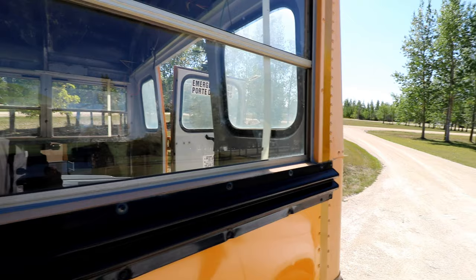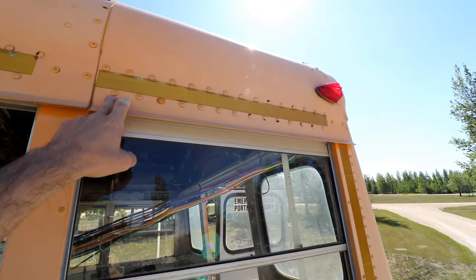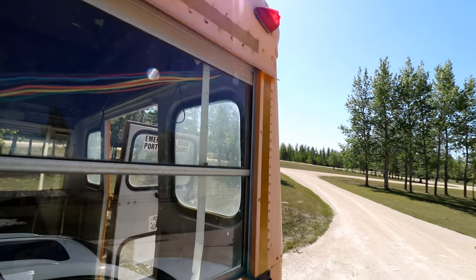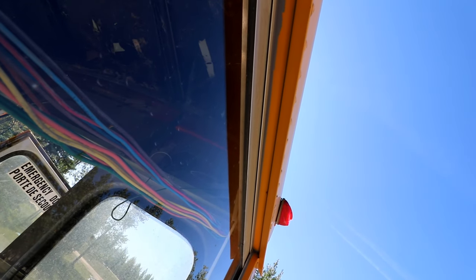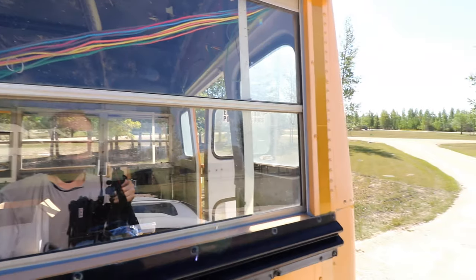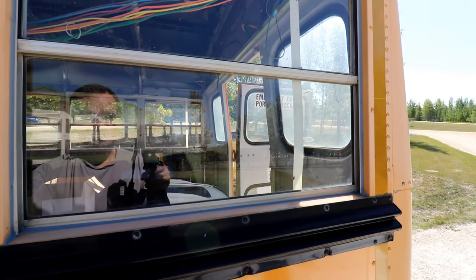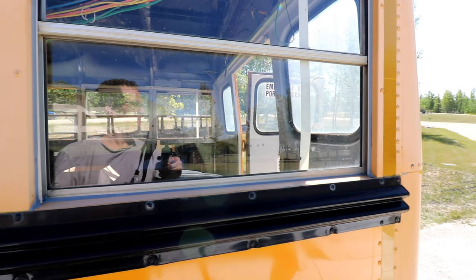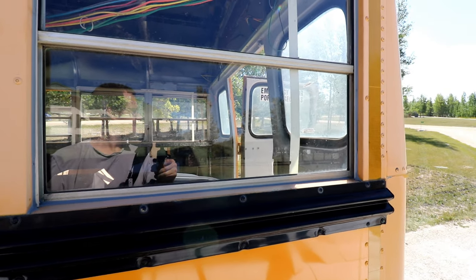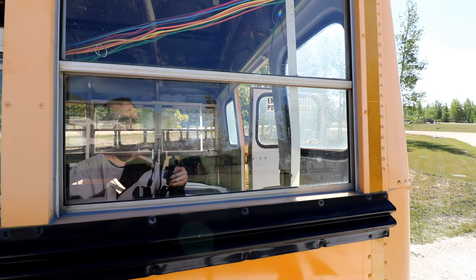Okay, we'll get started on the back window here. I'm going to just be removing these top rivets. I'll be removing that row of bottom rivets. I have all this caulking to get. There's even caulking under the drip lip. I'm not sure if you can see that or not. So I have to carve all this out in order to get the window out. Plus, there's a couple screws on the inside I have to remove. Then I have to clean this all up. A little bit of a windy day, so I'll set you up on top of my SUV, and hopefully you'll be able to see everything that I'm doing.